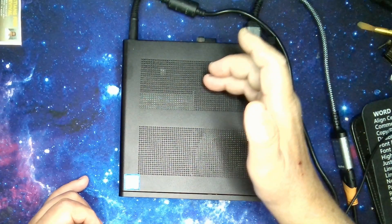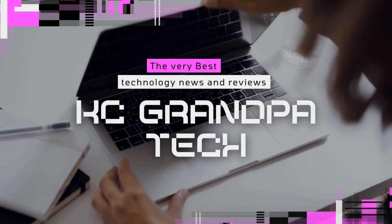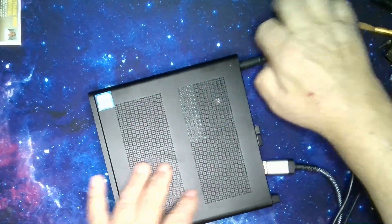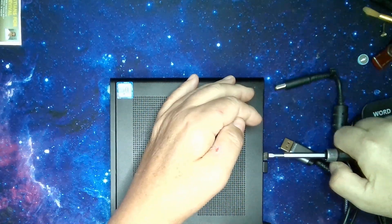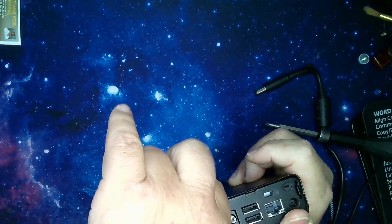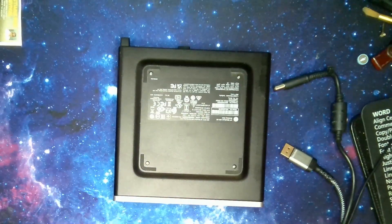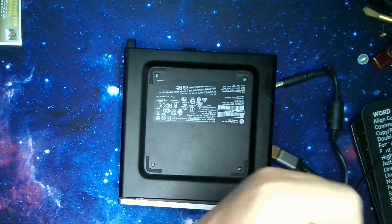The first thing I'm going to be doing is removing the cover. We're going to be removing the screw. First thing, obviously, we're going to have to remove power and connections to it, then remove the rear attachment screw which is in the back here — it's a thumb screw, you should be able to just loosen it. Flip the unit over. This is the simplest way. I've seen people try to slide and pull this. Get yourself a very fine screwdriver tip underneath here and then you'll be able to pull and separate the frame.